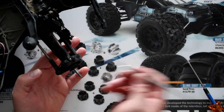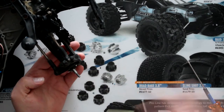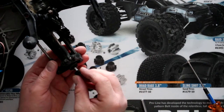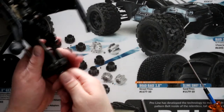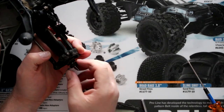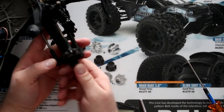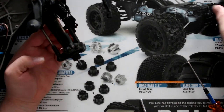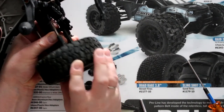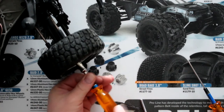Make sure your axle is fully out — I'll put it to the side where the hole is, so when I put my axle pin or X-pin back in it doesn't fall off. It's keyed. I'll hold the axle itself and wiggle it. You may hear a snap — sometimes that's just it seating correctly. As long as it's inserted correctly, go ahead and put the wheel back on and put the bolt back on.